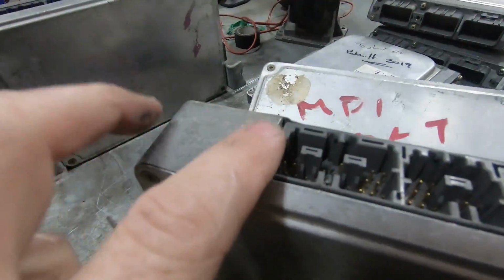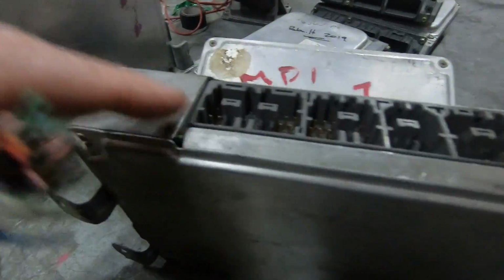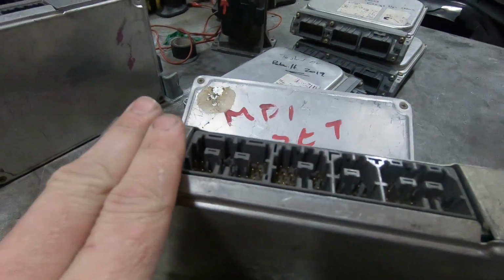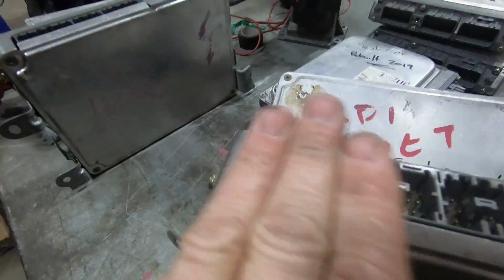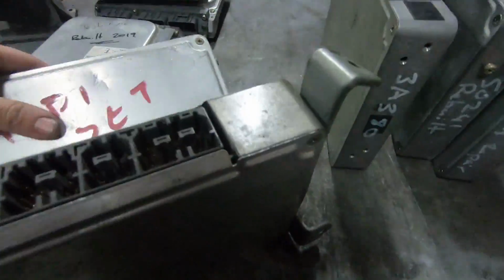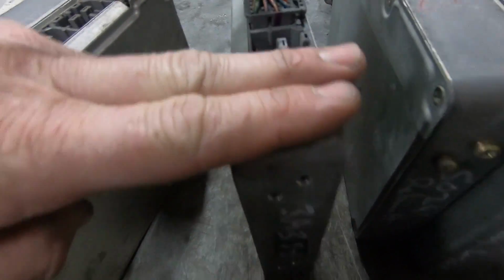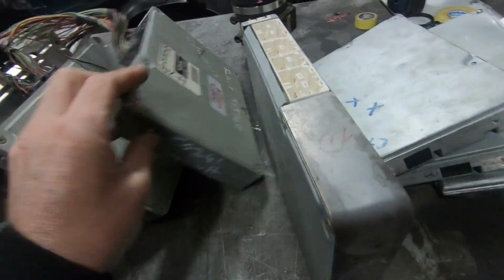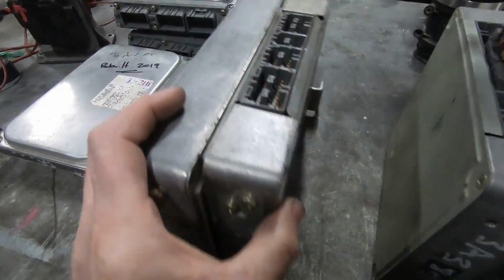We'll look at this. Here is one of your differences. And you'll notice the gap on the edge of the ECU. Gap on the edge of the ECU. Yeah, we'll call that 3 fingers, shall we? It's more than a banana. 3 fingers, like that. I've only got little fingers. If we look over to this ECU, it's clearly a 2 finger. And this one, the header plug is well offset. And so that's a really easy way of distinguishing between these ECUs, which all have the same plug.